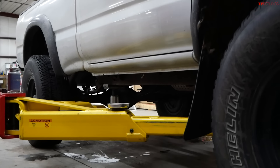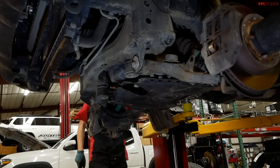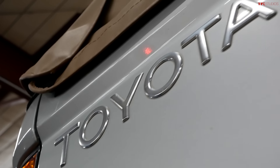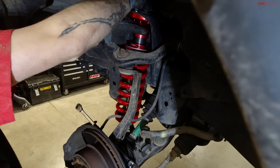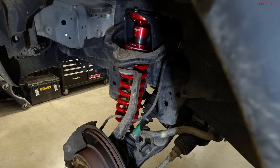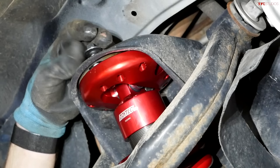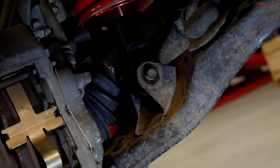So how simple is the front end — is it just unplug and plug in the new one? Yeah, it's pretty simple. There are three nuts up top and then one bolt down here. Some aftermarket upper control arms usually give you more caster and a little bit better ride quality or drivability, but nothing really wrong with going stock. The process of unbolting the front end and reinstalling our fresh new coilovers was pretty painless. However, it can be a pain point on these old trucks, especially four-wheel drive trucks driven in rust belt states that have the potential for major rust problems. If you are looking at building out a Tacoma, you're always better off starting with one that's clean, maybe from a western state like Arizona or California, than one that's old, worn out, and suffers from rust issues, because that will be compounded during the install.